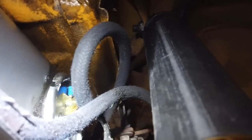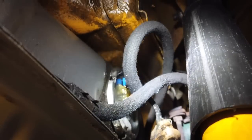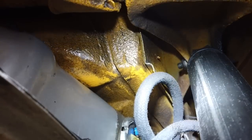and then you'll see the new sender just there. These pipes, by the way, were those overbraid pipes. If you've got overbraid pipes on your car, get them off right now, because they're just going to crumble to destruction. These have gone soggy already. You want R6 minimum on there, fuel line, otherwise it's going to go, and you're going to have leaking lines. We've replaced all bar these ones at the back on Ruby. I think all the other cars have been replaced, but these were not horrible at the time. They're only horrible now. You've got E10s and these new fuels which will attack these pipes. So these are due to be replaced.